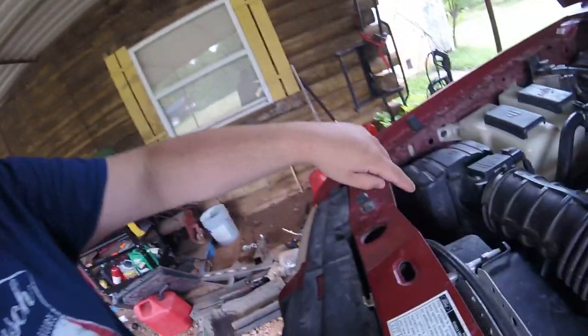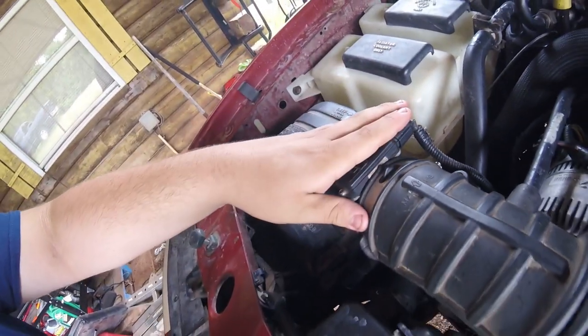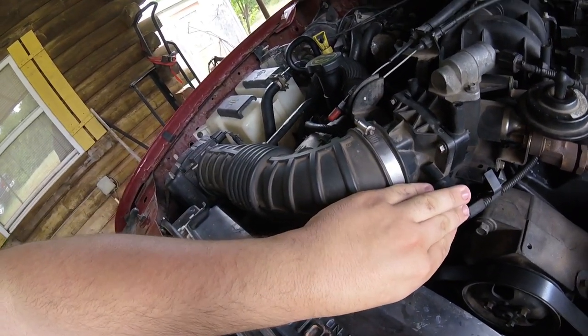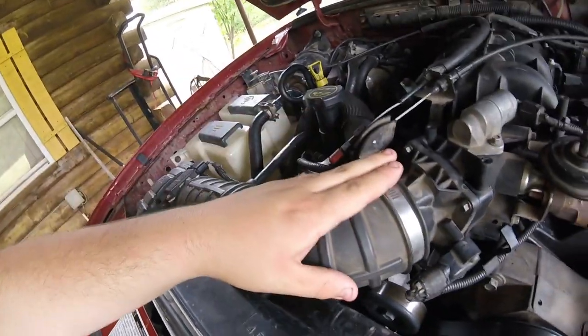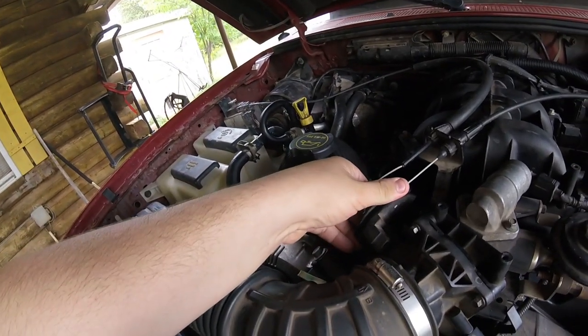And you do not have to take the intake off. All you have to do is take the clippies out of both of these, the air box, unclip the electrical connectors for the throttle position and the mass airflow, take this off, unbolt the throttle body, take it away from the cables,